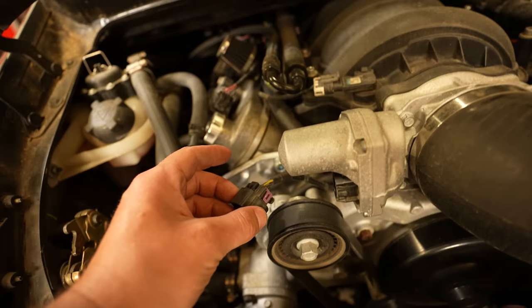It's probably easier just to look through here. I was kind of dreading back here where the OEM ECU is - essentially where all of the spliced-in wiring is down in there. Usually once you pull that panel up it looks atrocious, but this is actually really nice. A majority of it just plugs in and the CPE harness throughout the whole car is just actually real nice. So that was a pleasant surprise. I pulled the drive-by-wire harness back out and now I'm going to start unplugging the main engine harness.